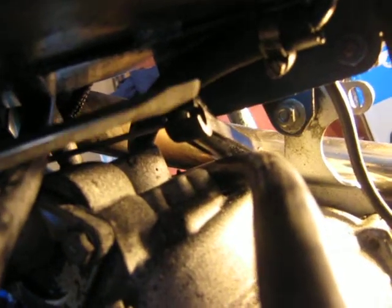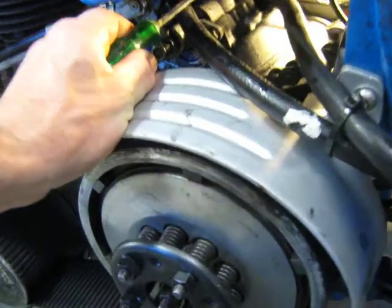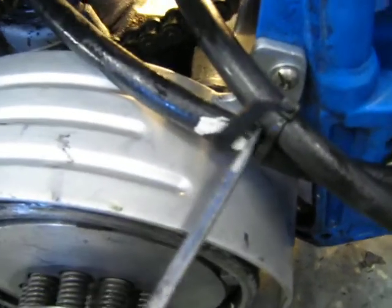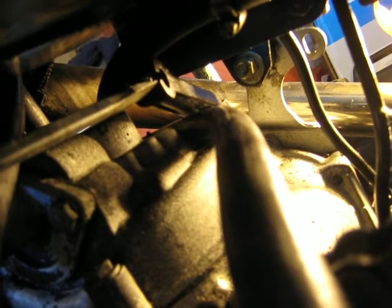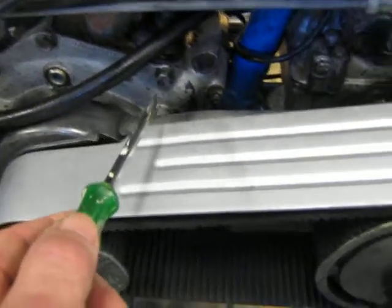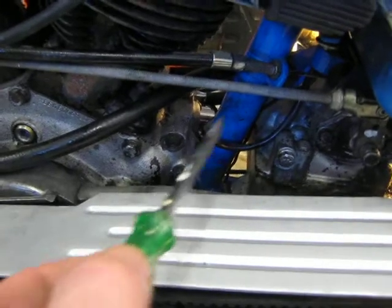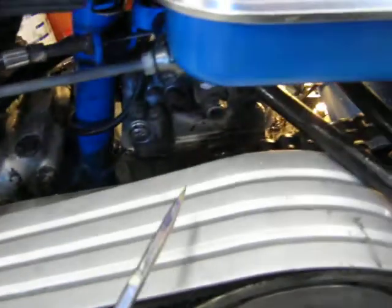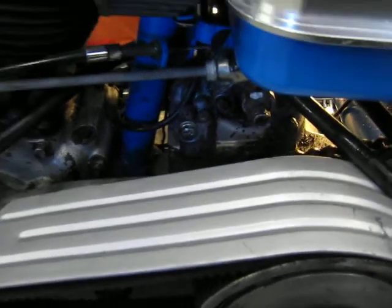On the other side here there's a primary drive — the belt drive. There's a belt drive cover, and the pipe sits on top of the primary drive cover, or on top of the other oil hose. I've got it clamped there on the oil hose, and I've got it clamped to the oil filter. You can see that it runs along and underneath and clear of the clutch gear stick — or the clutch cam system. I tried to bring the hose along the front of the engine for simplicity and not to get in the way of any operating levers or anything that might wear the hose out, but it all seemed safest going around the gearbox. I couldn't bring it across here because there wasn't any fixing point, so I found that to be the safest way.